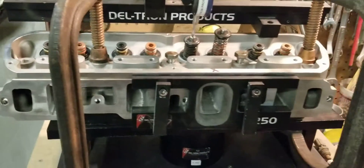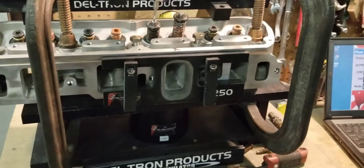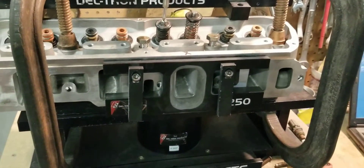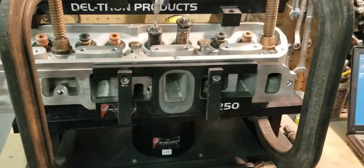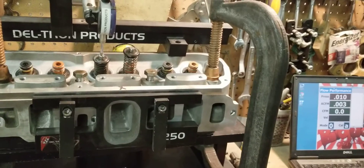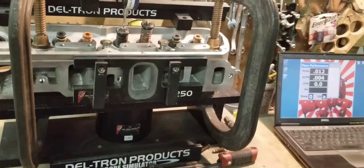This combo is going to make quite a bit of power — hopefully he'll be above 370 to 375. He's running catalytic converters, the high flow version, so I haven't flowed those and I don't know what they're going to flow. Without those cats, with the combo of parts he has, I'm pretty sure he'll easily be 380 to 385 or even more depending on the tune. With those cats I really can't say because I don't know if they're truly high flow or just decent — that can reduce the power drastically.